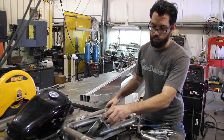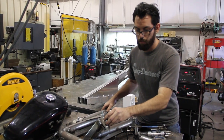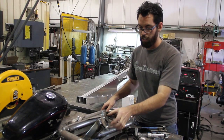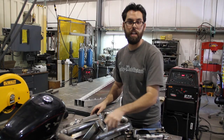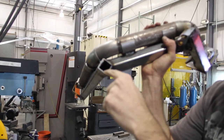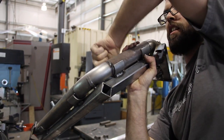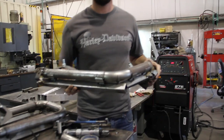You can see there's kind of a little locking pin piece of tube that locks the flange in there, and then you bolt the flange to it. Then basically lay all your tubes in there and start tacking it up. You can get to a lot of it because of the way I turned the tube up on its side — you have more room to get around the welds. So that's where we're at.